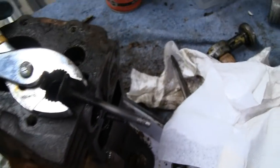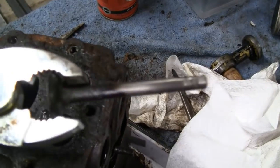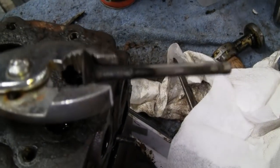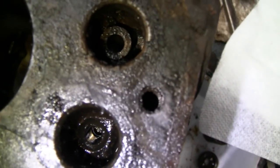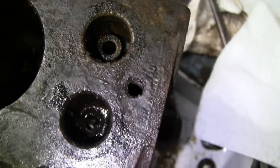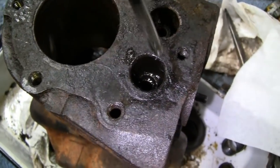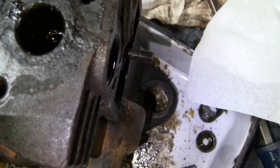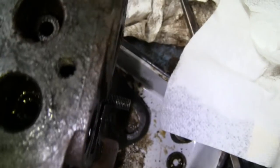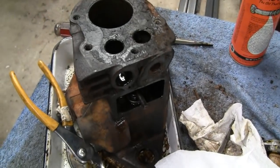I had a tough time getting this one out - I had to put the pliers on it and twist it, and you can see how thick the carbon is up there around the head. I squirted some Aerokroil in there and you just take it easy - you don't grab it so tight that you damage anything, just twist it back and forth and ease it on up. Just got to make sure we clean all the carbon out before we put this thing back together.